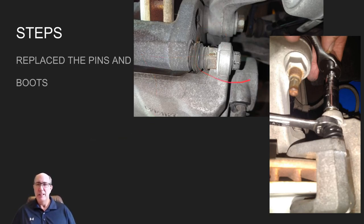To take it apart, it's super easy. You just take the wheel off and you'll see the caliper right there. This is what it looks like in the back of the caliper — this is how it's actually held on to the upright. You've got a bolt here that you're going to have to remove, and to do that you hold it with a 17mm wrench.